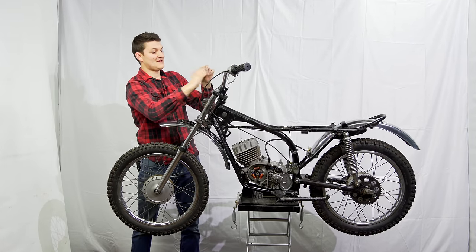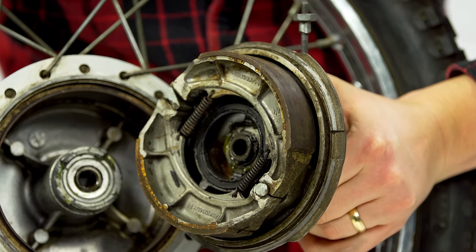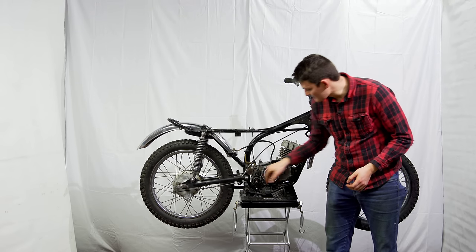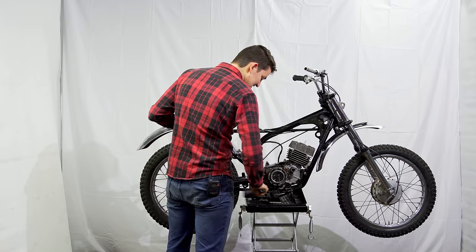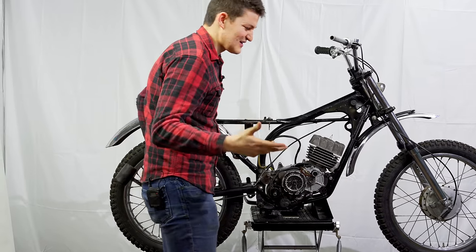The only hand control we have left is this — the brake lever. It pulls a cable, which pulls brake shoes against a brake drum. The same thing happens at your right foot with the brake pedal and connecting rod. On newer bikes, you have pads instead of shoes, grinding against rotors instead of drums, and actuated by hydraulics instead of cables.